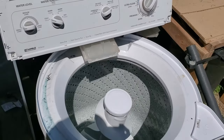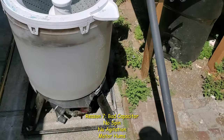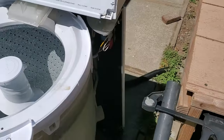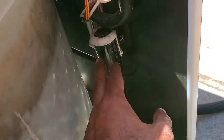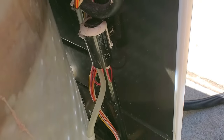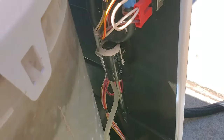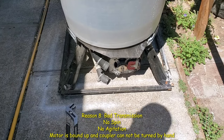That's very rare. Another reason your machine is not spinning — and this actually sounds similar to if the drain pump was clogged — is the motor capacitor. When that's not working, you'll hear a humming sound. If your drain pump itself is okay, you can measure the capacitance of this capacitor and see if it's within spec, or you could just order it for about $10, pop it in, and see if that makes a difference.